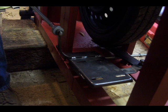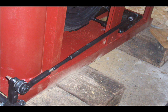You can also see the tail end of the linkage, which is the next step of the build. I wanted a linkage with absolutely no slop — just the best degree of sensitivity and finesse at the foot pedal. So we have a tie rod with an inner tie rod end on one end and an outer tie rod end on the other end. This gives adjustment as well as two ball joints, not allowing any slop or play in that linkage, which is running totally in a straight line.